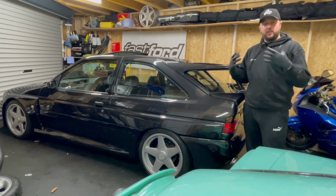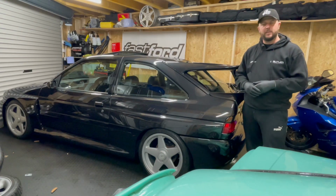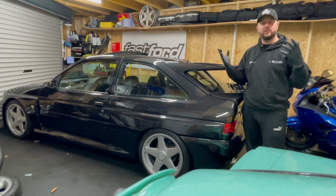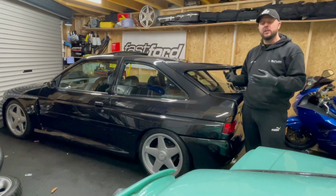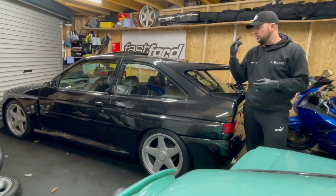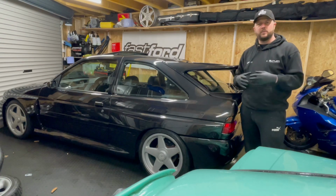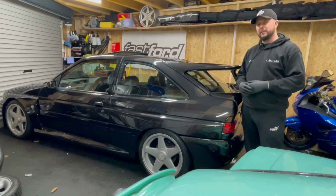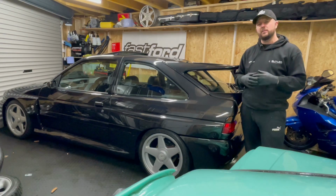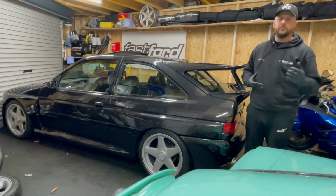When we started stripping stuff off, I decided to underseal the car to get it all wrapped up and protected, especially after getting the new sills done. And what we found, when we took down the back swing arms and the front cradles, was that everything was rotten. It was really, really rusty under there. You're poking holes everywhere. So instead of a repair, it became a complete repair and replace on here. So we've had patches in the back chassis legs all done, the front floor pans, anywhere where anything bolts on was really rotten to the core.